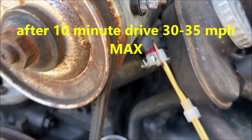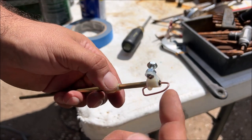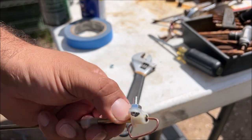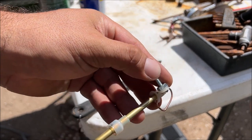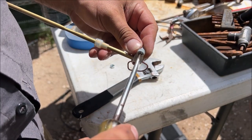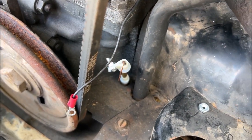The oil light was flickering, that's why I ran out here. You can see that thing is out of calibration. We just took the little wire off — this thing heats and cools super duper fast. 175 degrees was registering right here, so you should make a mark on there. We're just going to slide that over about a quarter inch, loosen it, move it over just like that, and tighten it up good. The oil is still about 170-175 degrees and you can see after we recalibrated it just a little bit.